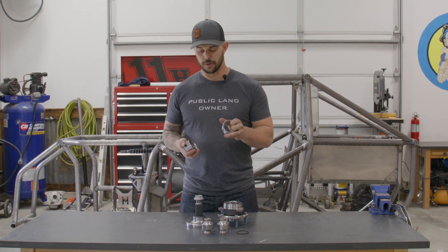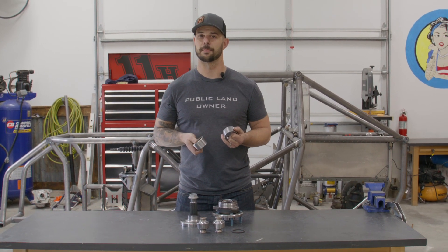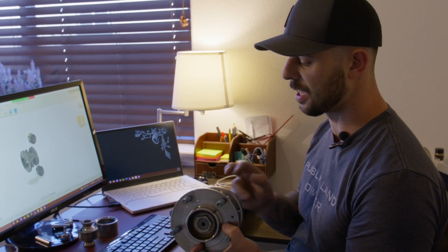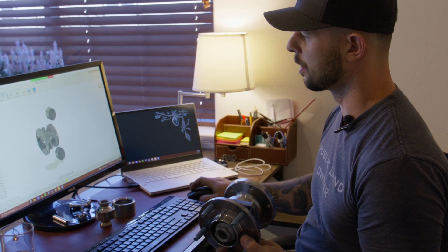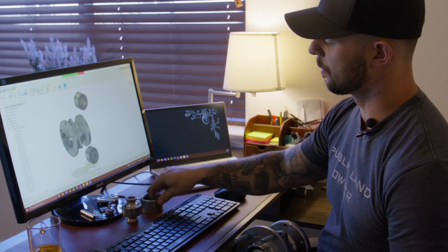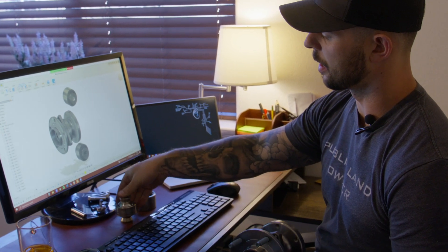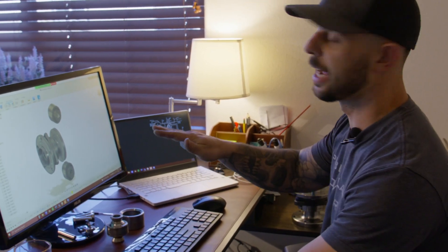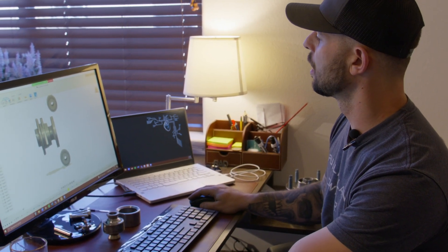Let's head over to the office and reverse these into CAD, then get into the actual designing of the upright. I went ahead and reverse engineered that C7 hub ahead of time, so we have it here in the model. I also have the cup and the uniball bearing modeled up. On a side view, we can see that the uniballs are spaced at pretty much the maximum I can have, and they're in line with what's going to be the CV joint.